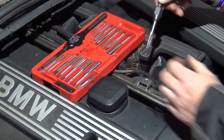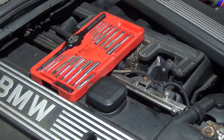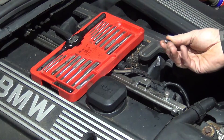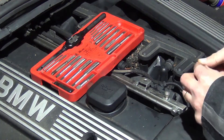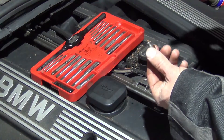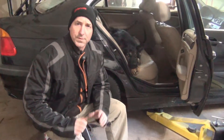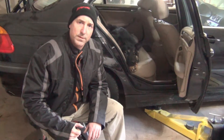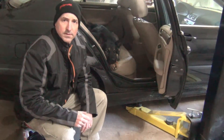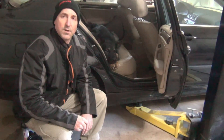Not rocket science — it's actually really easy to use and definitely something every mechanic should have. This is the bolt that belongs here — look at that, went on like nothing. So this is a skill you should have. You know how to check thread pitch, you can use a wrench to figure out what size the bolt is, and then you're ready to go. This was a 6mm with a 1.0 thread pitch — you pick your tap and away you go. Coming up next week I'm going to show you how to fix a stripped wheel lug hole. Thanks for watching — now you know how to use a tap and die set like a pro. It's something you should have in your toolbox. Please give it a thumbs up and subscribe to my Ask the Car Experts YouTube channel for more great videos.